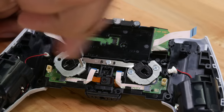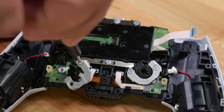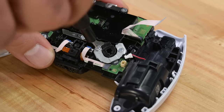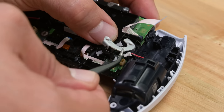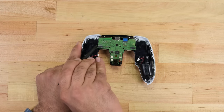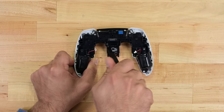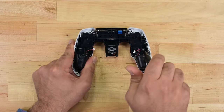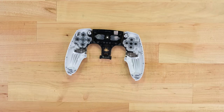Now here's something interesting. The paddles on the back of the controller are new, as is this circuit, and the mechanism is a tad intricate. The circuit itself is a super simple one though — there's a simple membrane button that registers the action, much like how your d-pad works. All in all, this controller is relatively modular and comes apart fairly easily. There are a lot of familiar-looking designs and components, like the rumble motors — they're not soldered on anymore, which is another excellent step towards repairability.